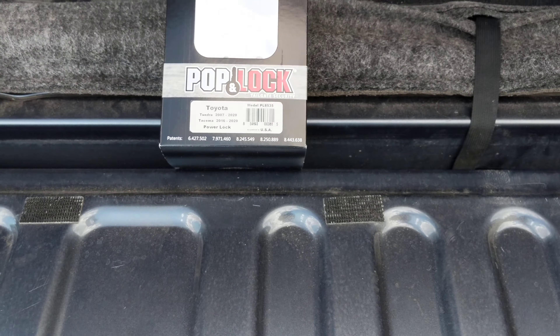It did say the third blue harness down, and I think this is the MJ1 connector they were talking about. They said it was like an 18-pin — I don't think that's what that is, but regardless, it's right here. The two wires they want you to connect: for 2007 through 2017 Tundras, you will splice the blue wire into a blue and silver dash wire, and then the green wire into a white with a silver dash.